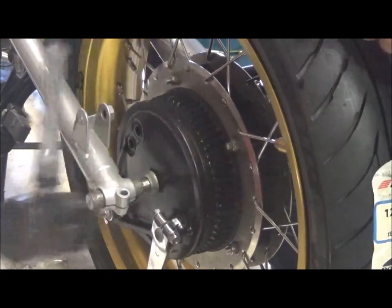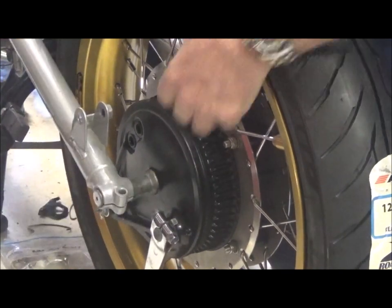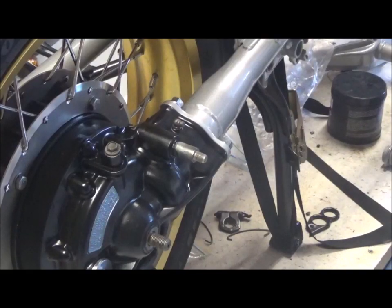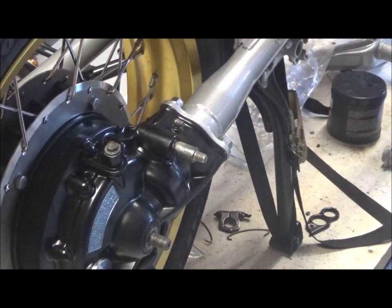Washers in place. Now I can do the nut up on the other side. First I'll tighten up the bolts to the final drive and then do up the nut. The swing arm mounts are done up to 33 to 44 foot-pounds — I'm going to do 38. That's a tricky one because the swing arm is in the way; I'm going to have to use an extended socket.